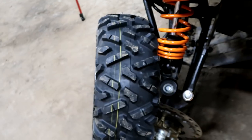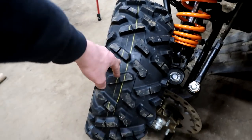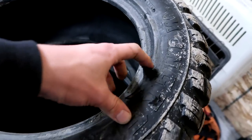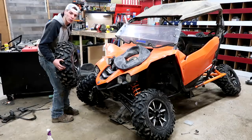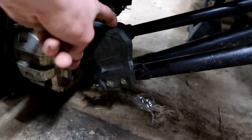I have the first rear tire on. This is what a lot of racers do — they run all the same size around the entire machine. I originally was going to run the same size tires that were already on Crush, and when I told Max's that, they suggested I run the exact same size all around. They make a living doing this stuff, so I'm going to follow their instructions. Now here's something that happens to a lot of off-road vehicles — you can see there's dirt in there, so this tire kept leaking. Or you can hit something sharp a couple times and that might cause your sidewall to leak too. Got all four tires on all four wheels. I also got a broken CV boot protector — it's supposed to look like this — and I was missing three hubcaps. I got all three of those in the mail as well.